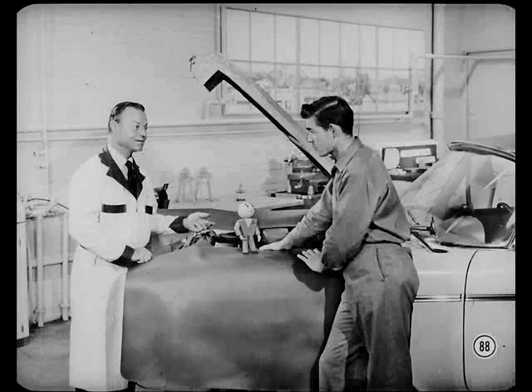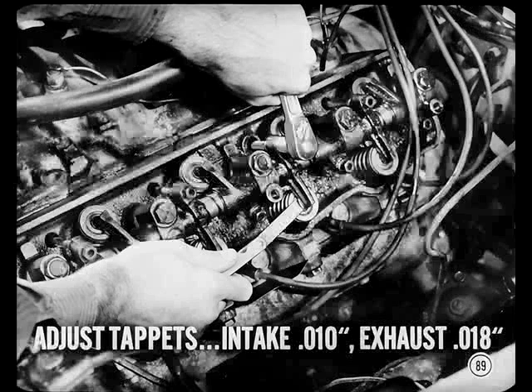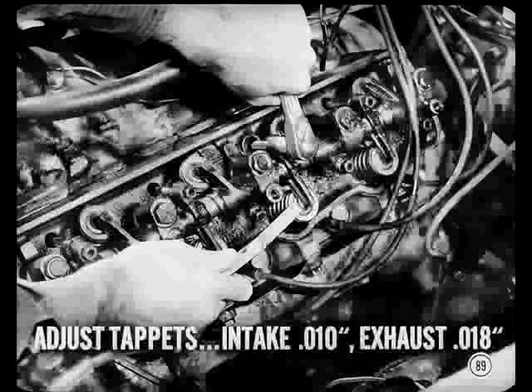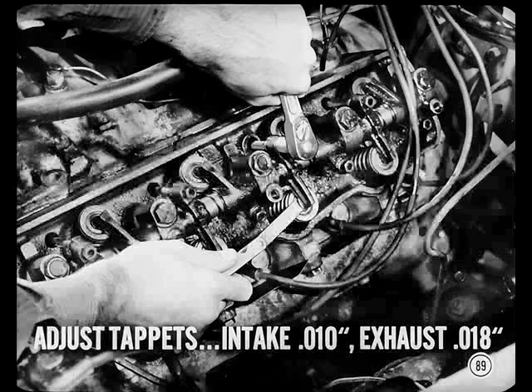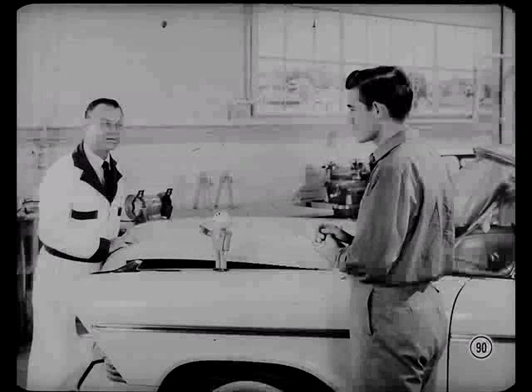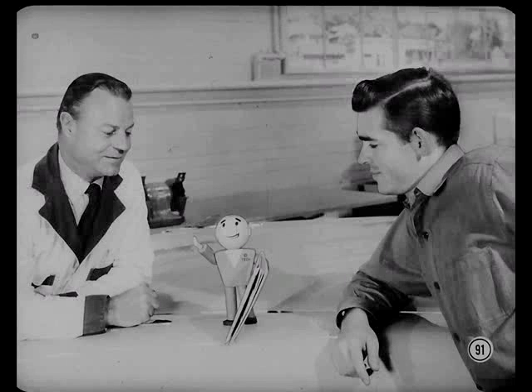Put in the proper amount of fresh MS oil along with some break-in oil. Run the engine at slow idle long enough for the oil and coolant to reach operating temperature. Then, on engines with mechanical tappets, adjust intake tappet clearance to ten thousandths and exhaust to eighteen thousandths. As a final step, take the car out on the road to verify the valve and bearing work. If anybody has questions, they'll find helpful answers in the reference book — use them to keep those customers happy.